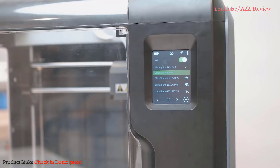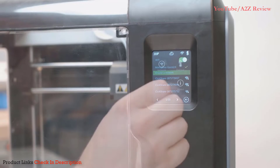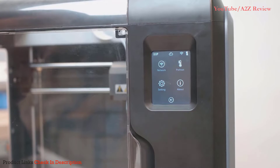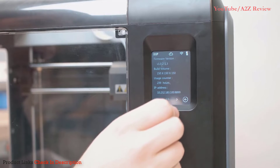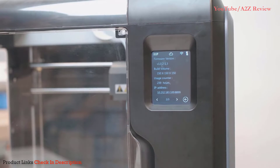If you prefer a wired connection, you're more than welcome to use the Ethernet port instead. Return to the home screen and select Tools, then select About. Locate the IP address that's on page 2 and write this number down for future steps.